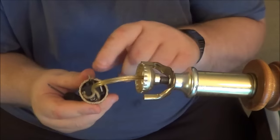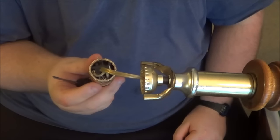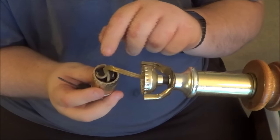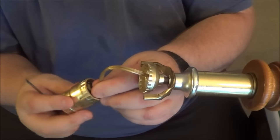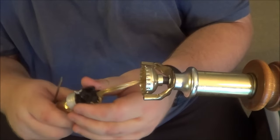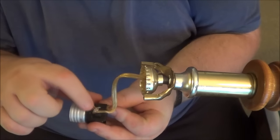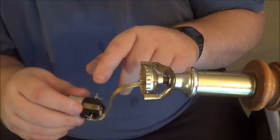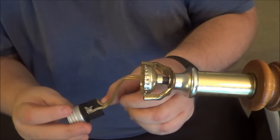If you look underneath here, now you can see where the wires are attached. There are little screws on each side — it's just like a normal lamp socket, but a little different. You can see the cardboard insulation in between the socket and the outer metal piece. These are insulated. When you take these apart, you're going to notice you have a silver one and a gold-copper-looking one. This is normal — this is identifying which one's the neutral and which one's the hot wire, or the line. So you need to make sure that you keep an eye as to which one's which.